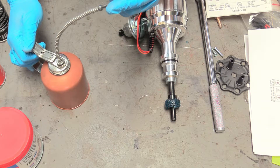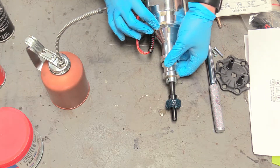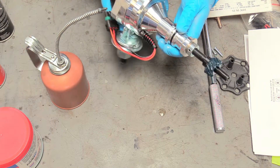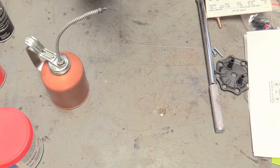Get a light coating of engine oil on your fingertips and apply it to the o-ring. Never put o-rings in dry or you'll shred them. A nice light coating of engine oil and we're ready for installation.